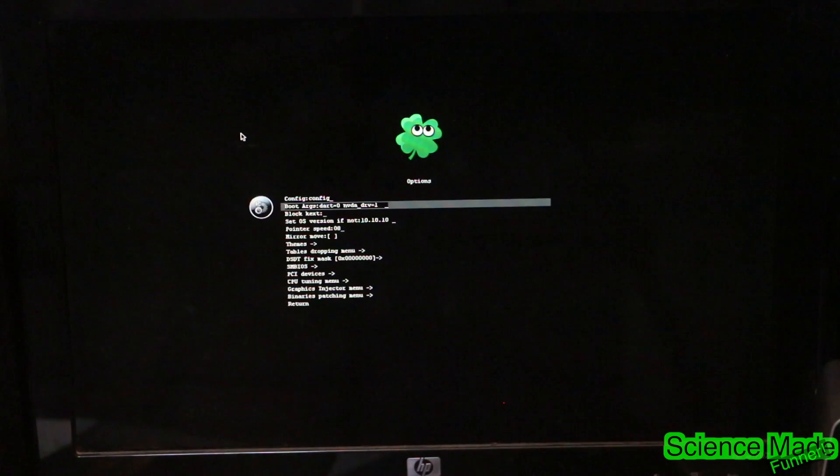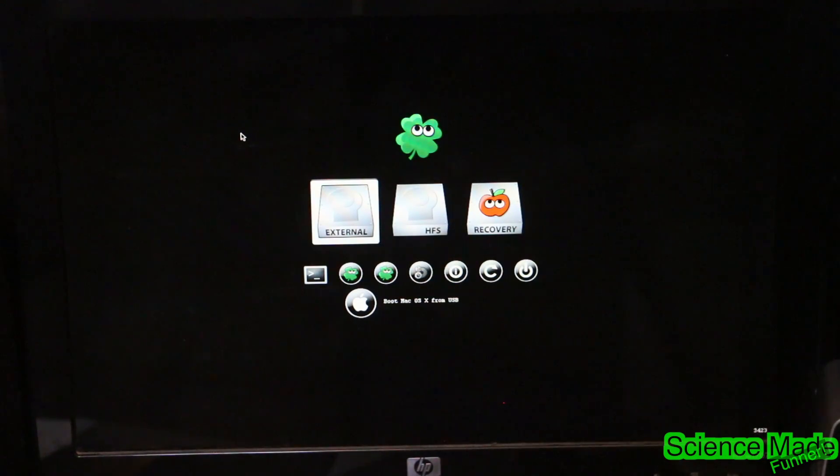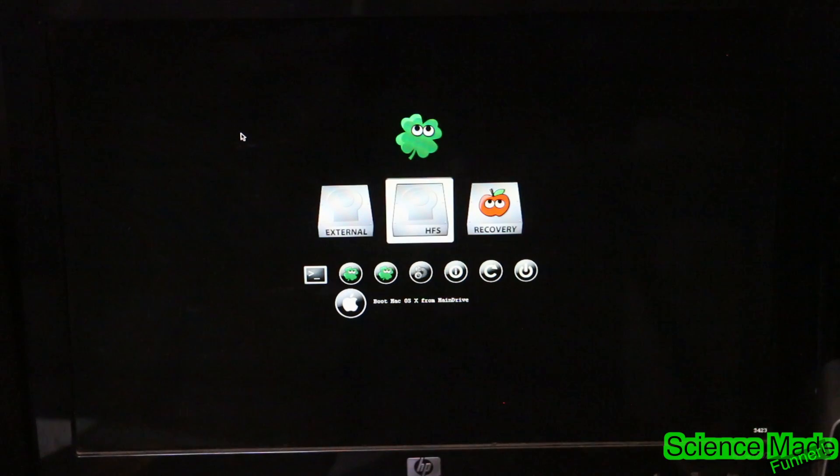I'm going to go down to Settings and go down one — this is basically how you type in boot flags. Boot flags are used for when you have a problem trying to boot into your computer. There's a link in the description with a list of boot flags and what they do. I'm going to add a boot flag here — it's called /V. What this does is instead of seeing a normal boot screen, you'll see the code, which works really well for diagnosing problems. So we're going to boot into the USB drive, not our main drive.